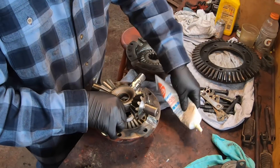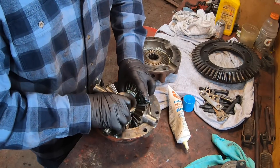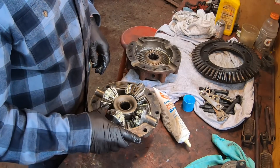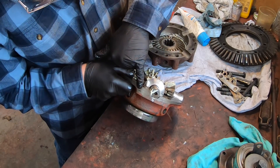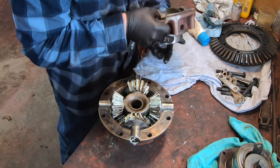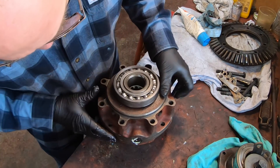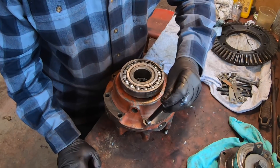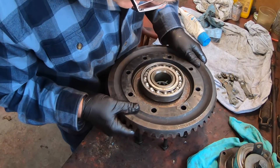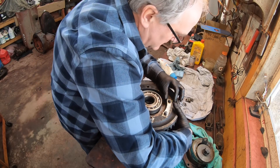Pull these apart and grease these shafts too. Now we want to put the two halves together on their alignment marks—see that chisel mark there? There's a corresponding chisel mark on the other half. We align those to get everything together in the right orientation. Put the bolts in, flip her over, put the ring gear on. MacGruber putting the differential together, hoping it doesn't explode.